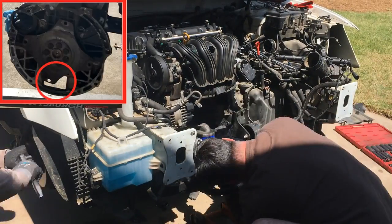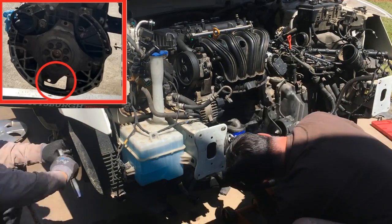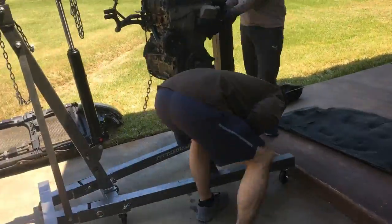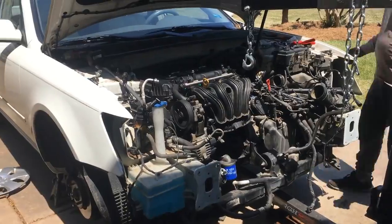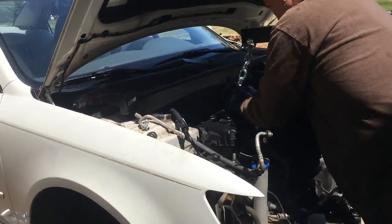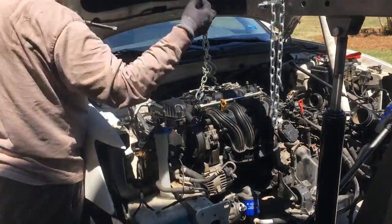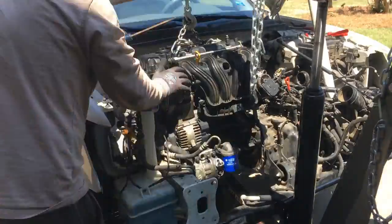In the video you see a two-man operation: one guy is rotating the engine while the other is lining up the bolt through the access port. Once this is done, remove the bolts that hold the engine to the transmission. Now that the engine is ready to be hoisted out of the car, hook up the engine hoist and slightly lift the engine up to relieve tension on the side motor mount. Remove the mount and wiggle the engine away from the transmission. Once cleared, the engine can be hoisted away.